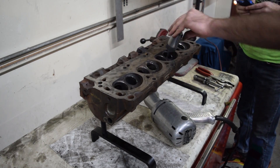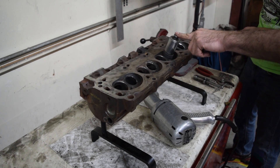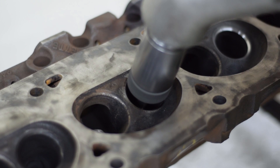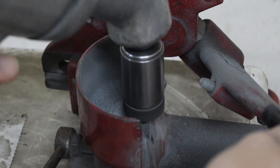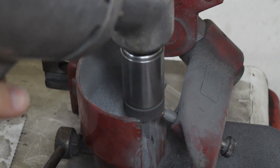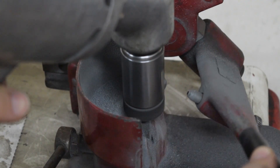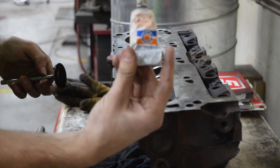Your tool here is just an electric motor that sits on the grinder and spins it. The grinder bit is spring-loaded, so you just gently press it in and it grinds just a little bit. Then you spin the tool on a cleaner — there's a little bit of steel on there that will clean off all the grime and gook that gets on the grinder as you place it into the valve seats. You just do this down the line.